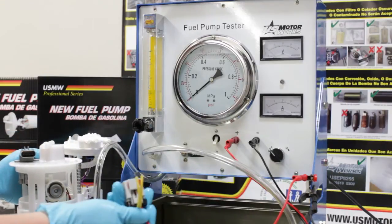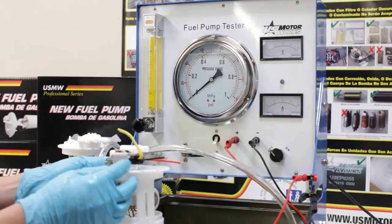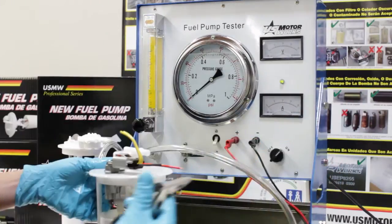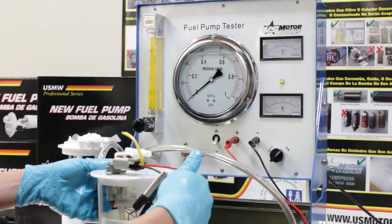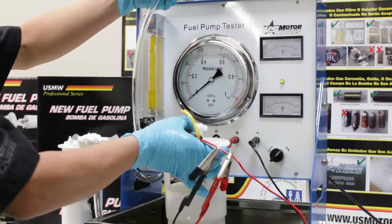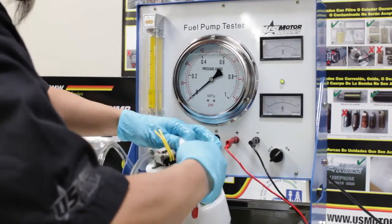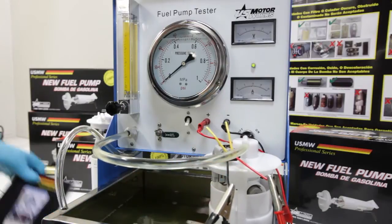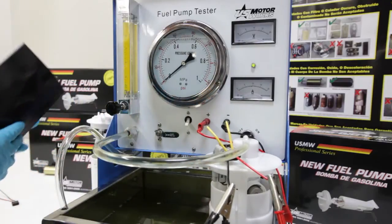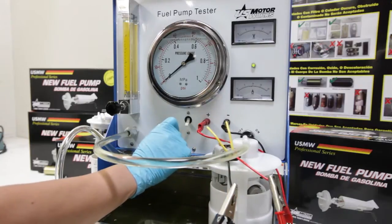The first thing you want to do is connect the adapter harness to the unit. These adapter harnesses usually come with our modules. If you don't have one, you can clip directly to the pins inside the connector. After connecting the electrical harness, connect the two power lines to the unit — black to black and red to red. Put the modular unit into the fluid, remove the input line, and connect it in the same manner as a normal fuel pump — just push it on and wiggle back and forth. The key difference when testing a modular assembly compared to a regular fuel pump is that you will test for pressure first rather than flow rate.